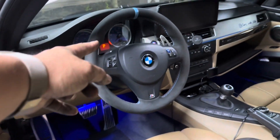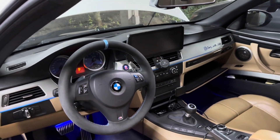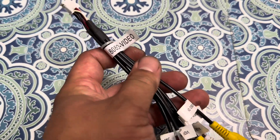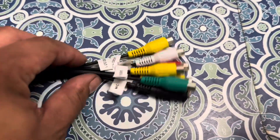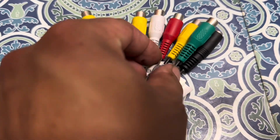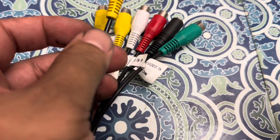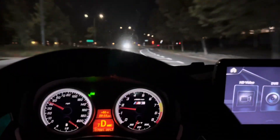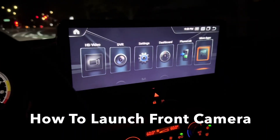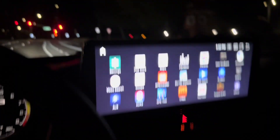The signal wire goes from underneath, through the gauges, and into our screen. On the head unit, these are the video connections right here — they're all labeled. The one you want to connect your front camera to is this yellow one that says 'Video In.'